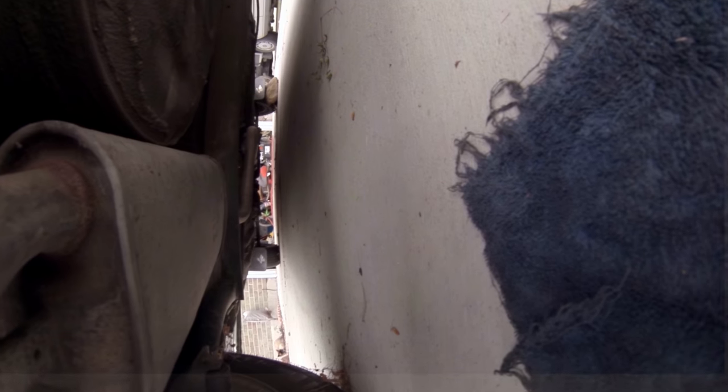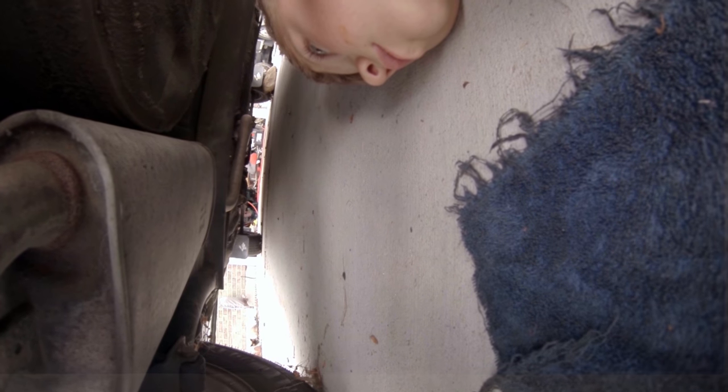This one was leaking out. Huh. Wonder if that wasn't tight enough, or if that comes from my wheel cylinder. Well, that could be my problem. Yeah, because that's coming from inside the wheel, or inside the drum. Inside the hub. It's not coming from the bleeder valve. So, I'm assuming that with that pressure, it just pushed it out there, because it shouldn't push out anywhere except for where we open up the bleeder valve.